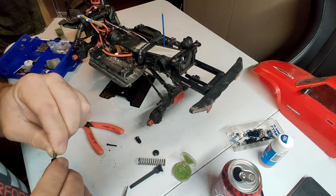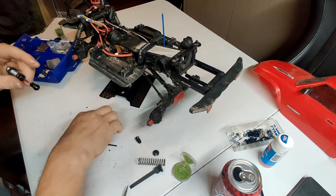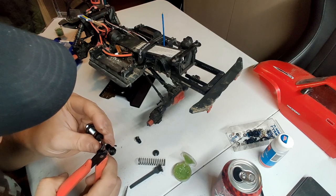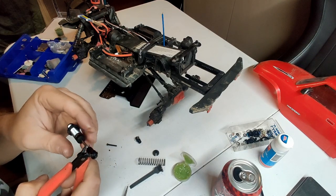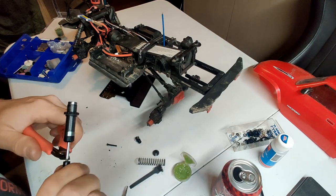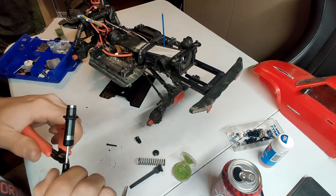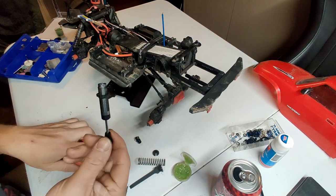Get this rod end threading straight, and look for the marks you made earlier. Grab in the exact same spots, so you're not adding any extra marks to it. Screw your rod end on. This end does not need to be tight. It needs to be screwed on to the end of the thread and no more.